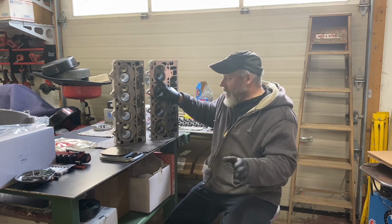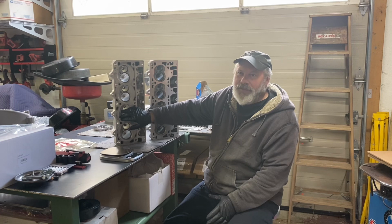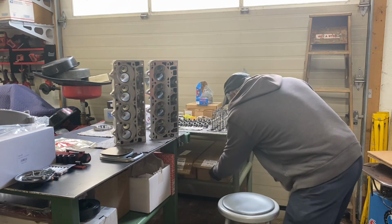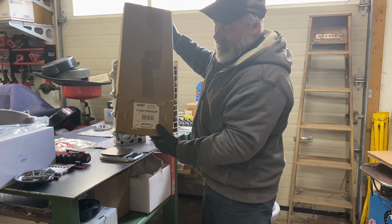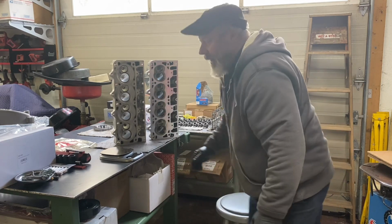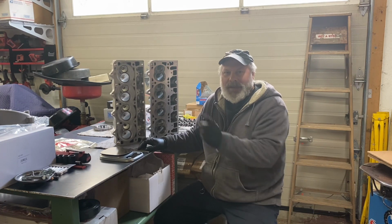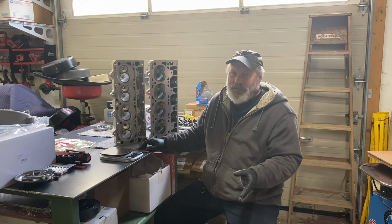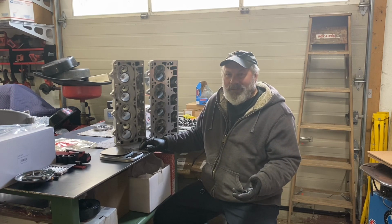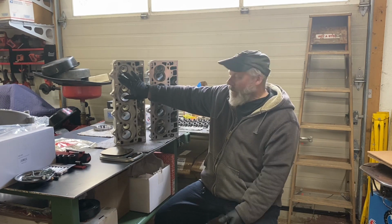That still remains to be seen, because the DOT head I have, they're advertised out of the box at 66 cc's, but those were the heads that were available to the public. These heads, the part number ends in ILM, Ilmor. It says Ilmor right on them. Likely they were never even available to the public. I don't know, but when I Google the number, all the digits come up as a DOT 285 CNC head, but it doesn't finish with the Ilmor. So I don't know what they did different for them that the general public may or may not get or want. So I'm going to have to CC the head, was going to anyway.